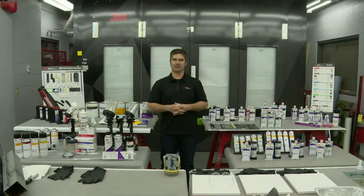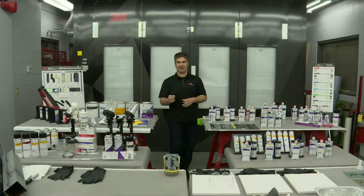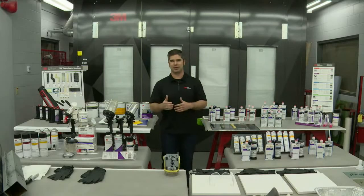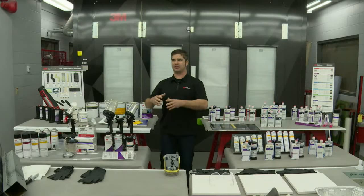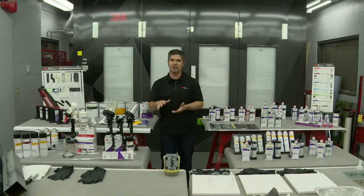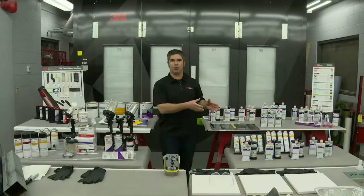Yes. I love the fact that they use the word corrode, and actually what it is, is oxidizing. I want you to remember that throughout this segment, because the misconception a lot of times is that steel corrodes, but aluminum is a self-healing element that doesn't corrode or rust. But it does. It's that oxidized layer, that white film that builds 30 to 60 minutes after the surface has been exposed. Rust, as we know it, is just a term. It's actually not what it is.